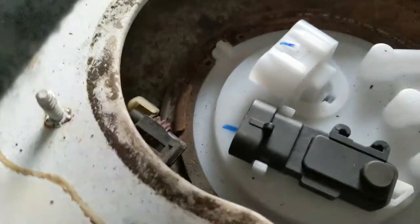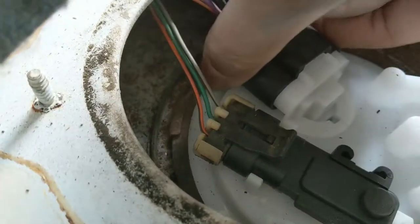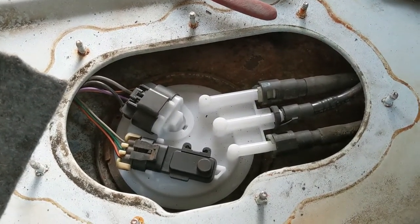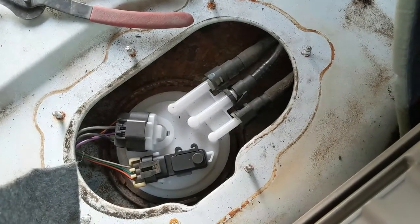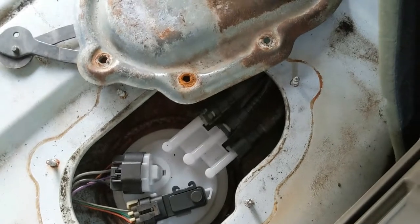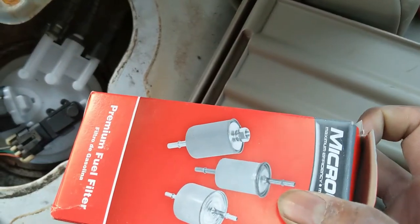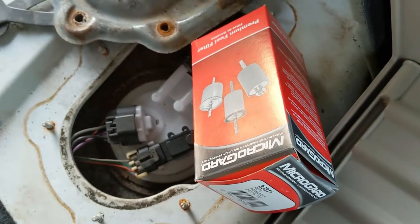We've got our fuel lines back connected and our snap ring is in place — locked in all the way around. Take our two connections and slide those up there until they click. That completes the installation of the fuel pump on a 1998 Buick Regal GS — it's a plastic Buick Regal, also the Park Avenue and other models as listed on screen. Don't forget to put your cover back on, put your 10 millimeter bolts in, and that'll complete your installation. Also be sure to change out the fuel filter — there'll be a separate video about that, linked at the top of the screen and in the description. My name's Erwin, this is the Thrills in a Block show — we'll see you soon.